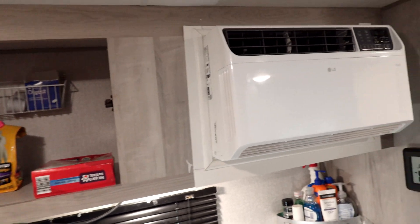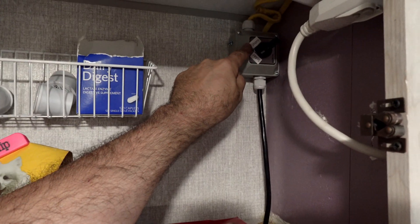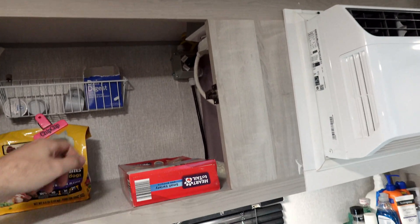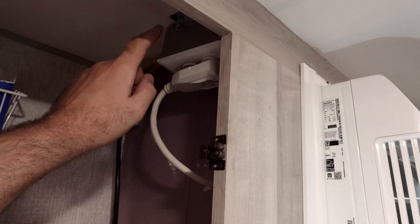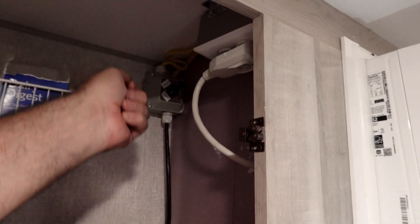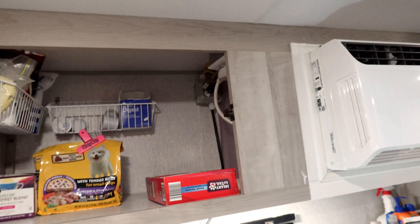The one thing you do convert back and forth is the air conditioner up here. I have a switch for solar and shore — you just flip it one way or the other, and in the middle it turns it off. You don't have to do it that way; you could have one outlet wired for shore and another for solar and just unplug and replug. I just wanted it simple, so I got one of these little switch boxes.